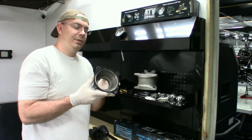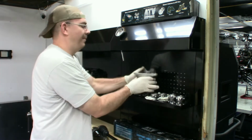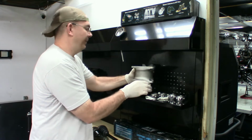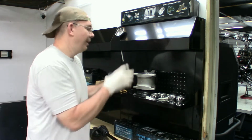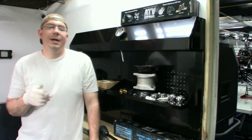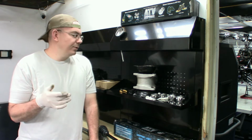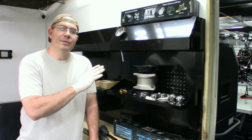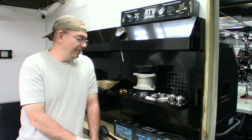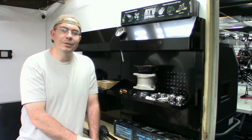They make this external carrier housing, but they do not make the internal housing anymore. It's a specialty machine thing, and if yours is worn out, you really don't have any options but to go to eBay and buy one used. So if you're starting to get some clicking noise or something's going on in the rear end, you really need to service these things. Or you're going to have a quad that basically is going to click and possibly destroy itself once the bearings go.